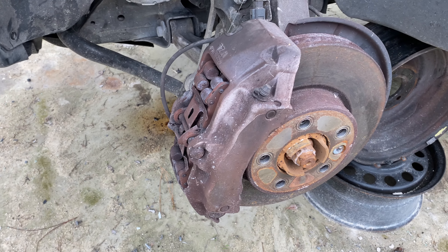Once you shave it down, you paint them and do whatever you need to do. For the front, they use the 14-inch GS350 F-Sport rotors, so I'm just going to pick up some cheap $30 aftermarket Centric ones — not the two-piece ones I used on my IS250. Those were like $250 each — no way I'm spending that on the IS300. For the rear rotors, these are actually bolt-on and fit using ISF rotors. Most aftermarket ISF rotors come drilled and they're not even directional. I found some cheap $30 blank ISF rotors on RockAuto for the IS300 Sport Cross — going budget and bling with these.